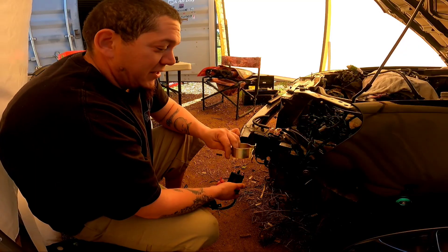The reason I am putting this in is because the track states rules that if you relocate your battery out of the stock location, you have to have a kill switch running to the back of the car to turn off the car in case of emergency — it's a safety issue. I'm going to show you guys how to do this because there really isn't a lot of videos out there on how to do it.